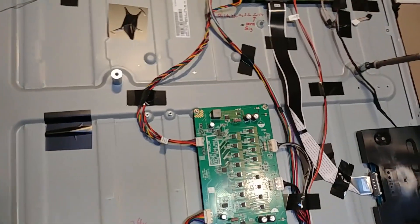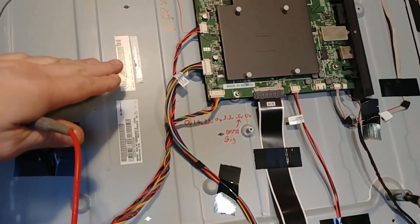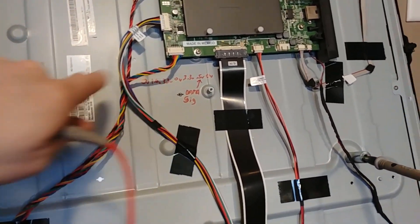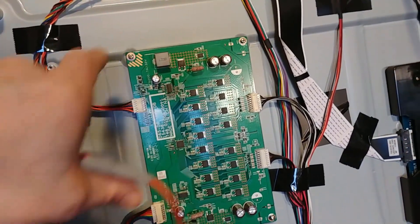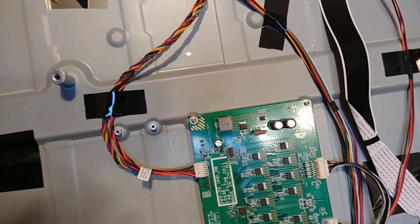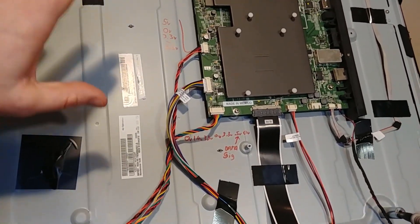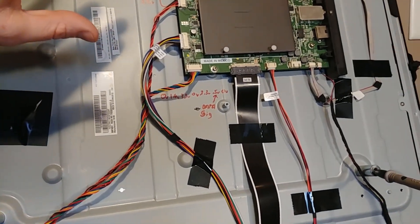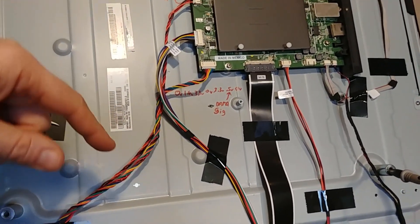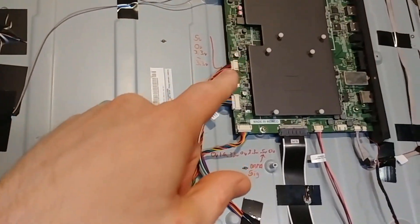The main board — I have already pinned out the turn-on signals. There is a data line to feed the active backlight dimming, which is all done through the LED control board, the LED driver board. But the main board has no change of state when the backlight shuts off by itself, so I know that the on-signal is still being sent. I'm not concerned about the main board; it seems to be fine.